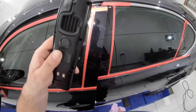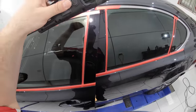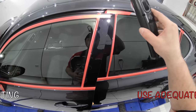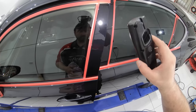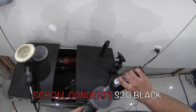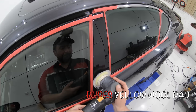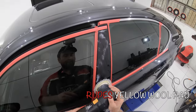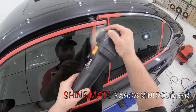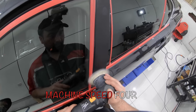So to start with, it's vital to mask the surrounding rubber and plastic trims, not only to protect the trims themselves, but also to protect your pads from picking up that rubber and plastic residue that will almost certainly flaw the finish of these super soft and sensitive trims as you polish. It's also important to note that the masking tape's residue itself will potentially scratch the finish as you wipe it. So before I do the final wipe with my cloth, I usually remove the masking tape first, as these trims are just so sensitive to everything.